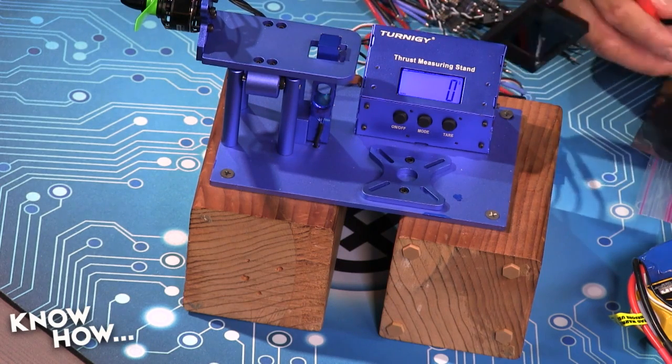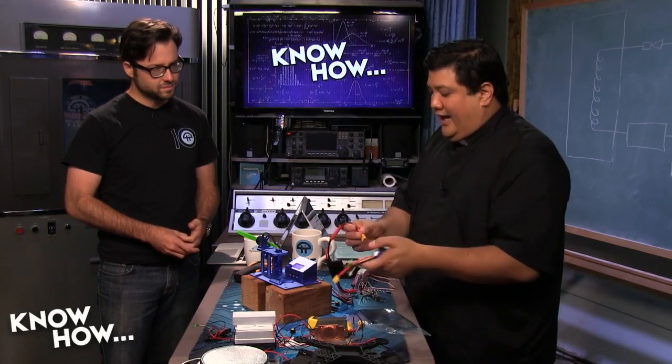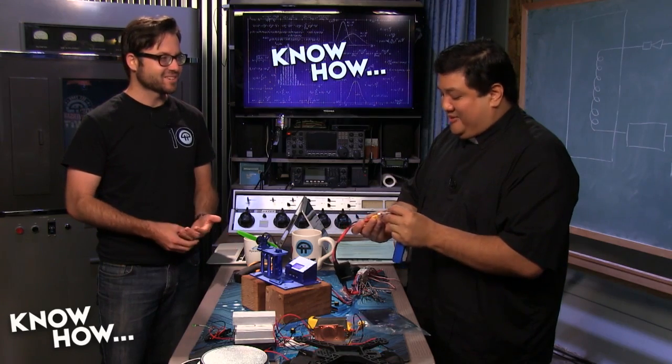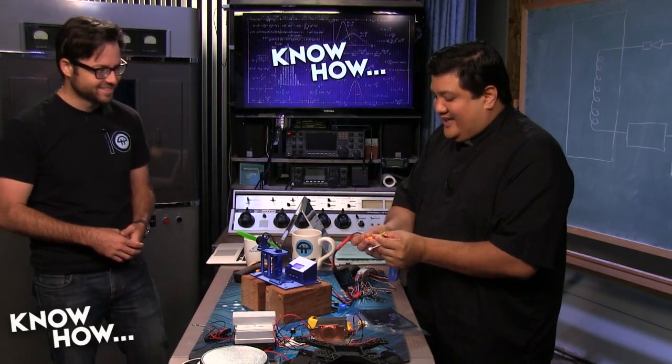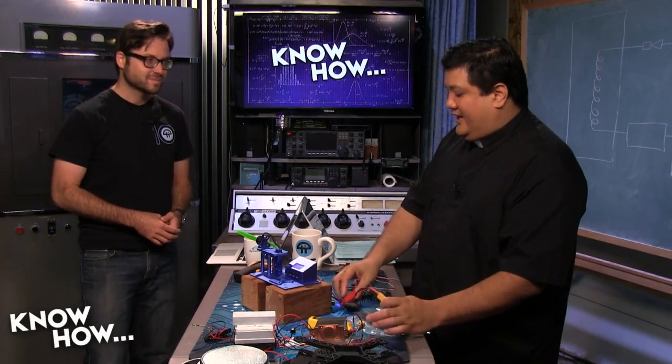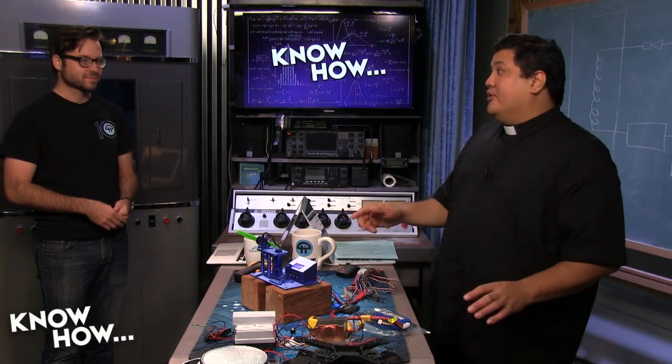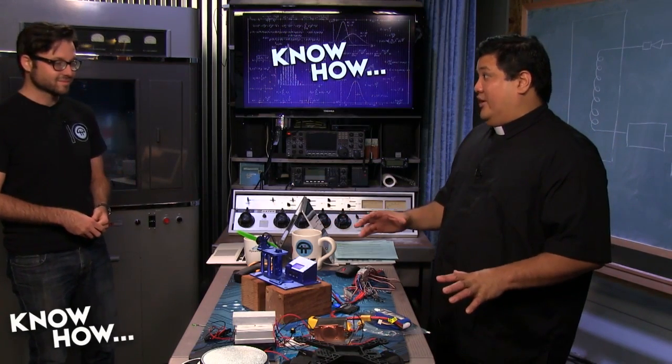I'm going to lose an ESC, right. Now, I tested this at home, and... you're still alive. So I'm still alive, with a 6 amp, with a 6-inch prop. And with this motor, I pulled about 920 grams of thrust. I would not do that here because I actually snapped 3 props just from the sheer thrust.